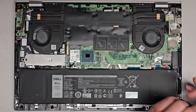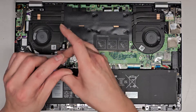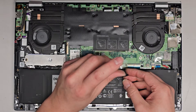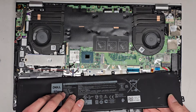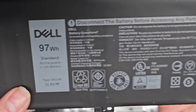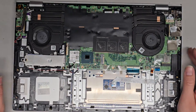There's one screw at the bottom, two on either side, and three at the top — so we'll get all of those out. It's interesting — it's still turning on even with the battery connector pulled back like that, so it's not completely out. On these newer laptops, they use the main battery as a CMOS BIOS battery as well. I'm getting my finger underneath to pinch the wire and wiggle and pull it. There we go. The battery model is 4K1VM — that's the model. The connector is part of the battery on this one; a lot of Dells have removable connectors, but this one doesn't.